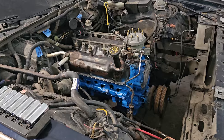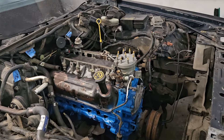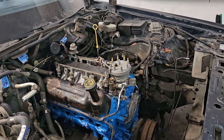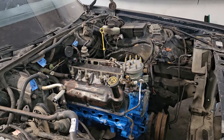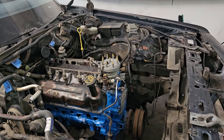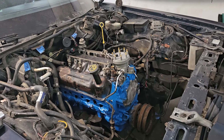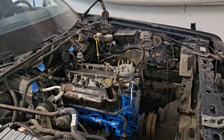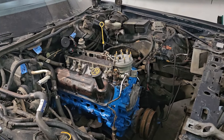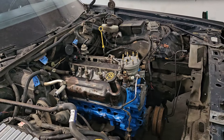Right now I'm just waiting to get myself dirty in here and pull the valve covers for paint and replace. I'm going to do the O-rings on the fuel rail and on each injector. It's been a bit — most of these gaskets are 30 years old. Pulling them out and disturbing them, I just don't want to have any issues with high pressure fuel leaks. I just don't want to go down that route.